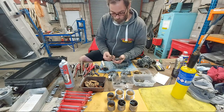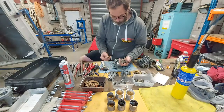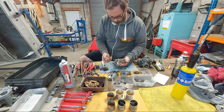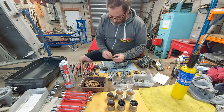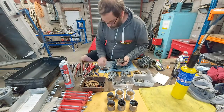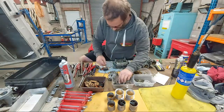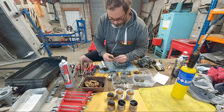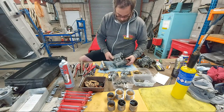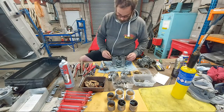When you're squirting fuel, but when it's creating the pump action in the car, it's so it doesn't push it back into the float bowl and through the jet. Okay, so that's just the casting. That's got a rubber O-ring on it. We'll leave that like that. Okay, so the pump housing is out, so we're just left with the stubborn spindle.